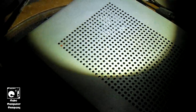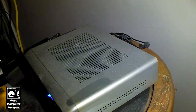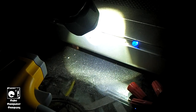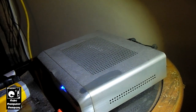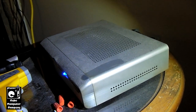The laptop motherboard in there is like a perfect square shape, so it fit right into this old set-top box. What I had to do was take the daughter board and solder on the leads for an LED and the leads for a power button. Those buttons there by the way are non-functional — they're just there for looks now. This thing stays on all the time. The fan only comes on once in a while, but hey, at least it has a fan.